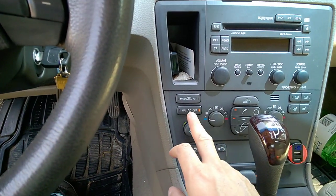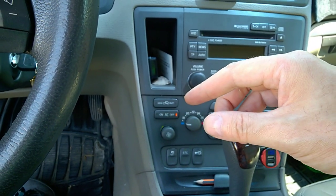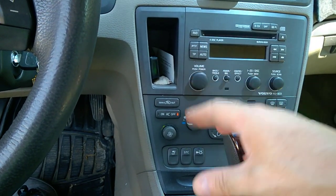One thing: turn the AC off, because it runs the radiator fan and that cools down the transmission fluid. The fluid inside the transmission cooling line continuously flows through the radiator. There's no thermostat, so keep the AC off.